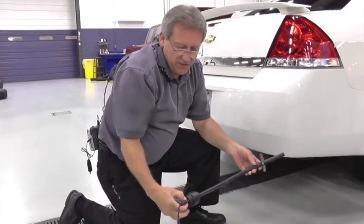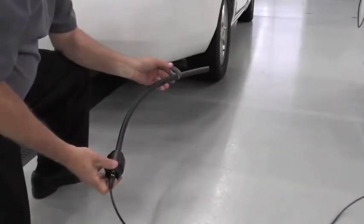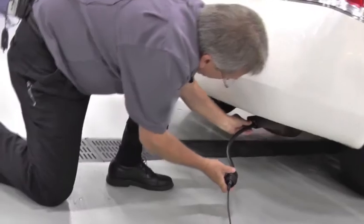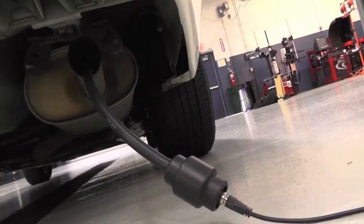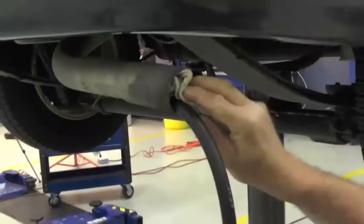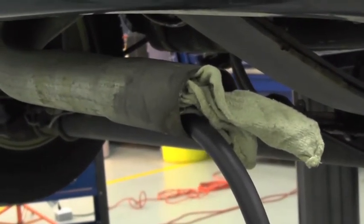With our First Look connected to our BNC coupling, we're going to compress these springs backward. This will allow us to stick it into the tailpipe so it'll stay — just gently insert it. Now, depending on the exhaust system and its quality, you may need to put rags, wet preferably, into it, as this allows the pressure in the system to be more accurately sensed.